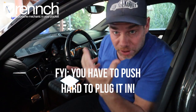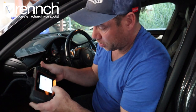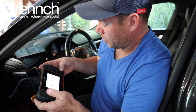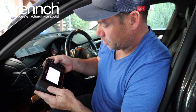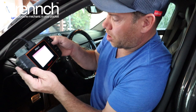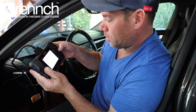I want to apologize for the lighting right now, because I'm kind of in the shade. My options here are diagnose, settings, and help. I'm just going to hit diagnose and see if I can start without knowing anything about anything. There's a keypad that allows you to go up, down, left, right, OK, and escape. I'm going to hit OK for diagnose, then select Porsche, and hit Porsche diagnose. Version 1130, checking files, and it's going to ask me what car I have. So I'm going to say Panamera, which is the 970, automatic.